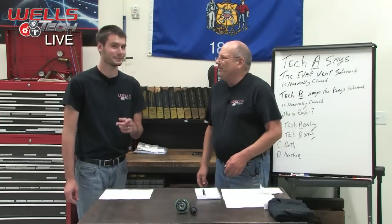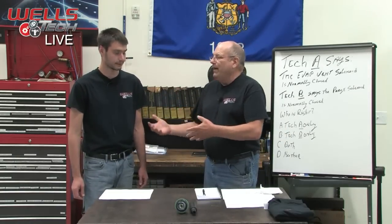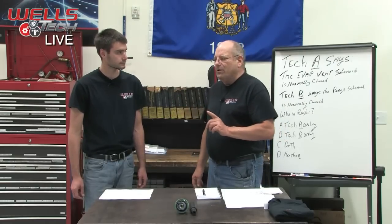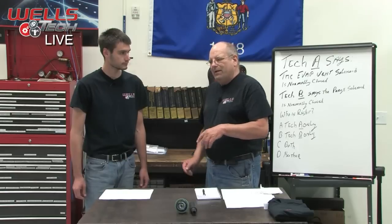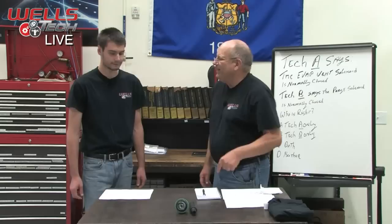All right. Today we're going to be talking about EVAP systems, specifically on an '07 Pontiac Grand Prix, a car you're very familiar with. You had a problem with a P0455, a large leak, and it turned out to be a vent solenoid, we think, at this point. What we're going to do today is go through the system and how it functions, but look specifically at that vent solenoid, because we did some out-of-the-box testing on it to really verify that's what failed.